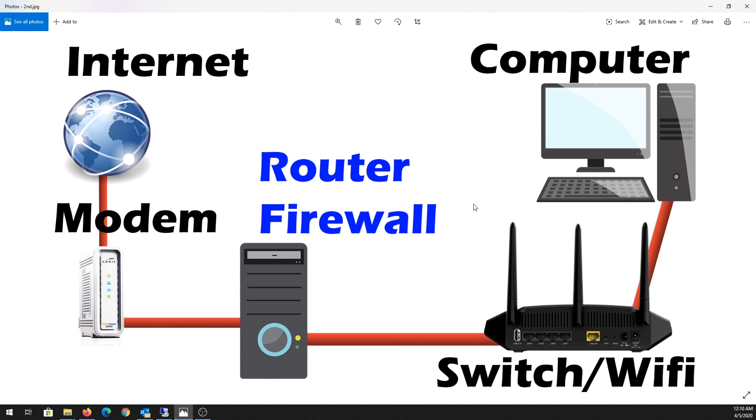And this is what it's going to look like after I hook up this firewall router into my network. So again this is my internet, this is my cable modem. From the cable modem it's going to be connected to my firewall router, and then from my firewall router I'm going to connect into my router slash switch slash Wi-Fi. And what I'm going to do instead of connecting into the WAN port, I'm just going to connect directly into one of those LAN ports, so that way this is going to act like a Wi-Fi switch. And then from here I'm going to connect my home computer.